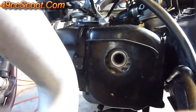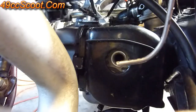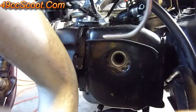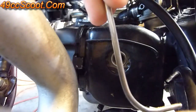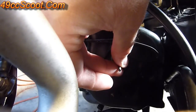You'll want to start out by removing the spark plug wire and spark plug, and then you need to bend the solder in kind of an L shape like you see here. That way you can maneuver it into the cylinder and get it right up against the edge of the cylinder wall. Hopefully you've got enough left that you can easily hold it outside of the cylinder. Get it in there right up against the edge of the cylinder wall, up at the top of the cylinder, and hold onto it.